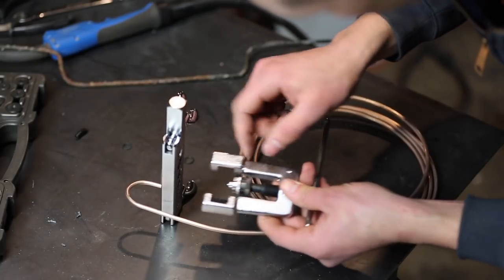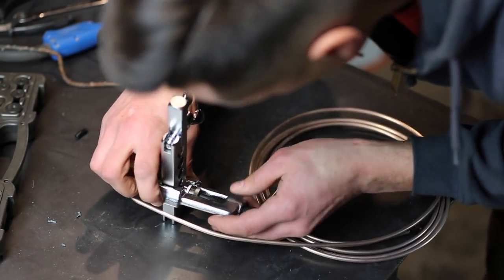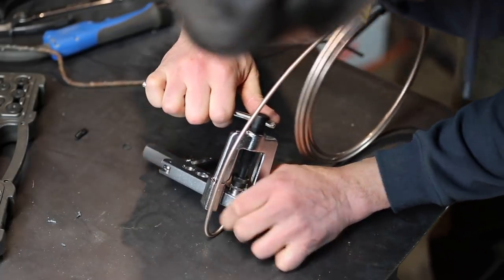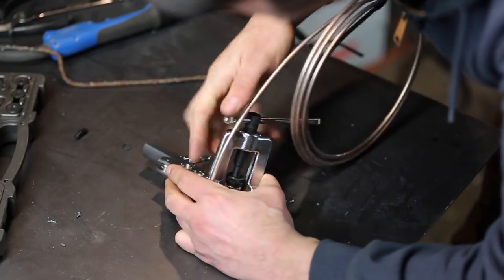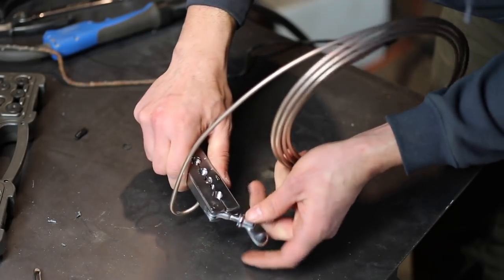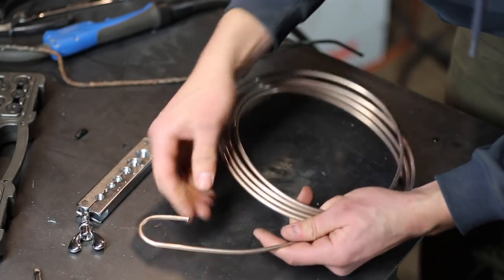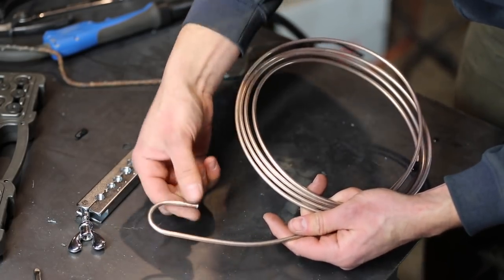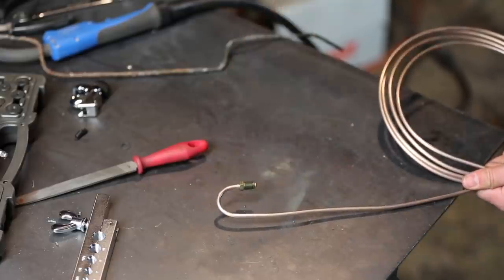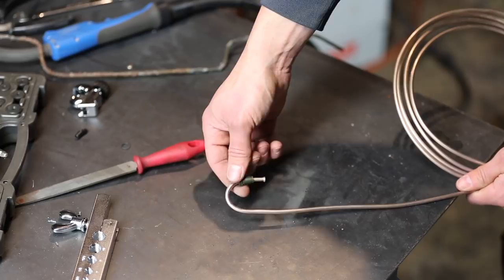And then I'll go ahead and throw this bubble flaring adapter on here. And we got a beautiful bubble flare. And of course, I forgot to put the nut on this. And there it is, it magically appears. My recommendation will be to follow the instructions, even if you know what you're doing. It'll help you to avoid forgetting things like this.